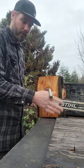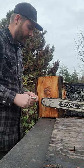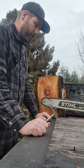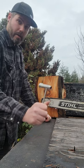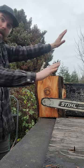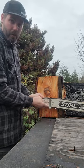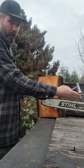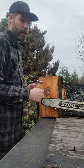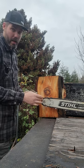People don't grasp that concept — they just say 'oh my god, you're gonna kill yourself.' You'll also see me one-handing when I'm doing a back cut; I'm holding the tree and looking up in case something goes wrong, so I can push myself away. The saw is cutting bottom bar into the tree, dogged in — it cannot kick back if the tip is in open air.